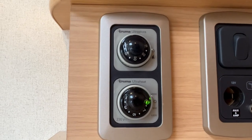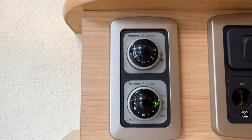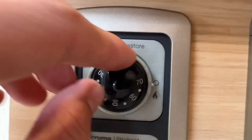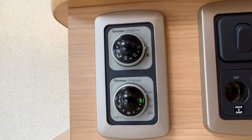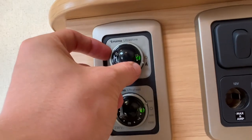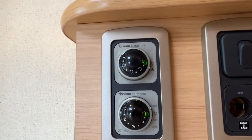To operate hot water on gas, use the top switch. The cover on the outside of the van must come off first, as explained during the walk-around. You can choose the temperature: 30 or 70 degrees. It's a 10-litre capacity boiler that self-fills — once it uses 10 litres, it pulls in another 10 litres and warms it up. Turn down to the gas flame setting and it'll go green. If it goes red, either the cover's been left on, you've run out of gas, or the gas bottle is not turned on.